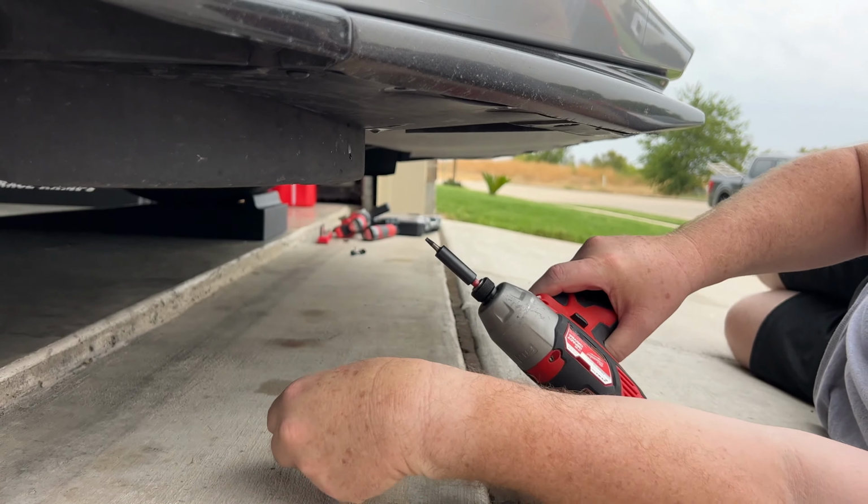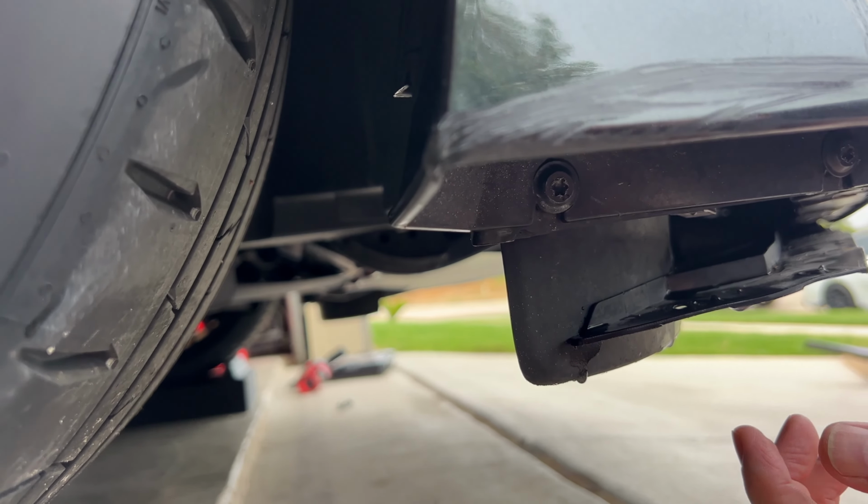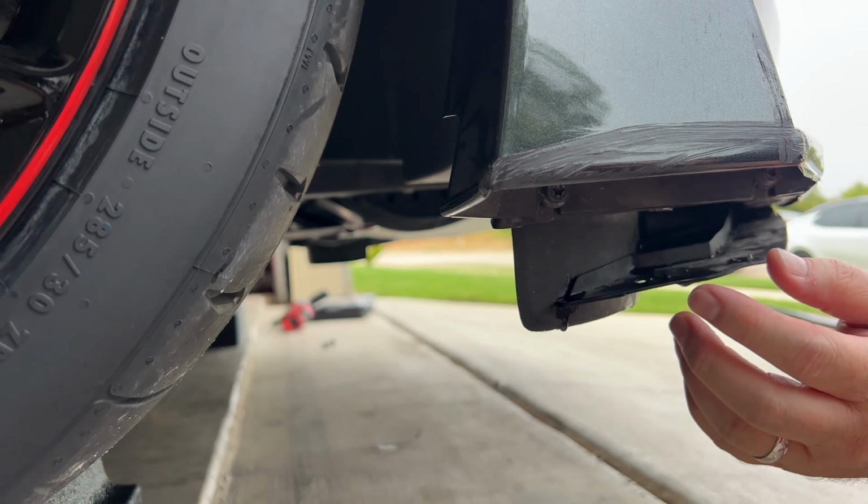everybody wants the winglets. Yes, they do. They look so aggressive. So we need that so we can get in behind here, because there is actually a couple of nuts in here right where these screws are. Okay. So we're going to need a T30 for each of these. And you're going to need 10 millimeters. So on this one, you can reach it with a wrench. So you can use a 10 millimeter wrench on the back side. On this one, you're going to have to slip a long 10 millimeter back behind to reach it on there.